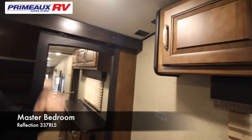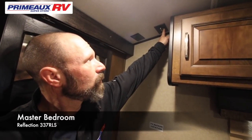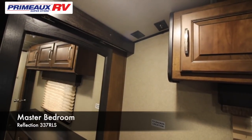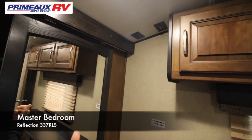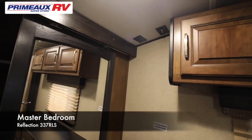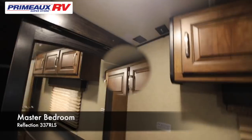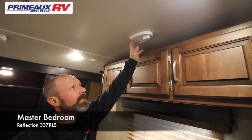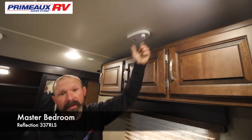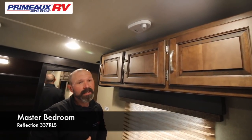Here is where your amplifier button is. You're going to see the little green light — now it's off. What that does is, if you're running off just the antenna when you're camping, you press that button and that gives you more power to catch more channels. Remember, if you plug cable into this camper and your picture is distorted, you're going to want to turn this off, because now it's too much power and it doesn't need it. If you're running off just the antenna, press this button and turn it to get the best picture you can — stop and leave it right there. You don't have to worry about breaking the antenna.